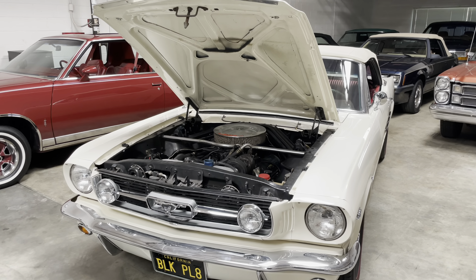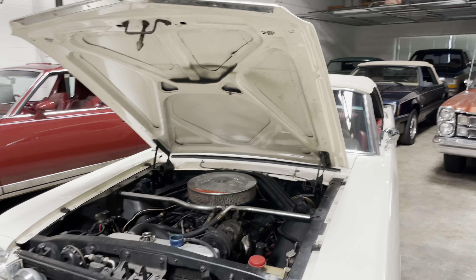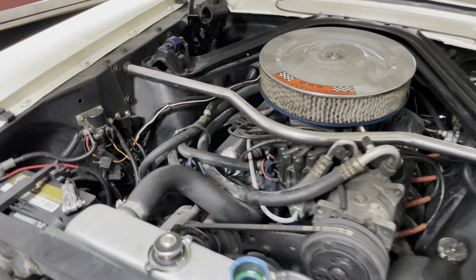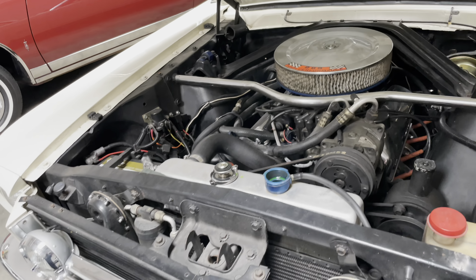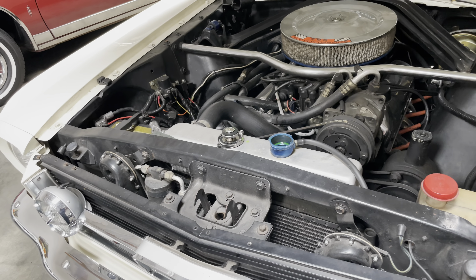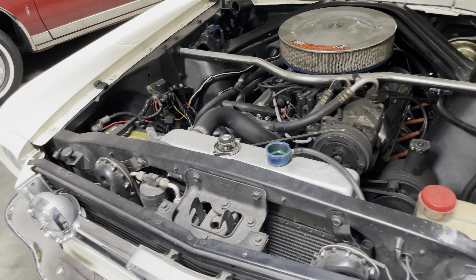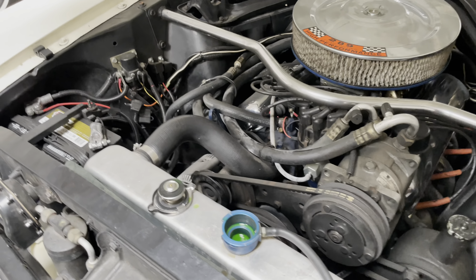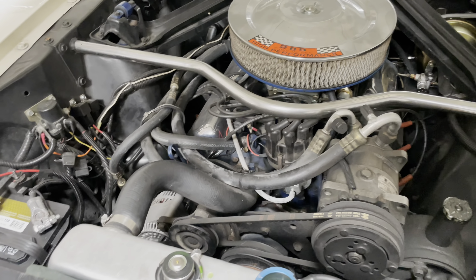Here we are yet again on Barry 66. Last time we had an issue where we weren't getting any pressure on the cooling system. So we got him a nice cap and put it on, had him drive it. She's still getting hot — it was like 120 the other day, it's down to about 102 today. So we're going to pull the thermostat and put in a brand new 160-degree fail-safe and go from there.